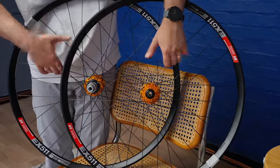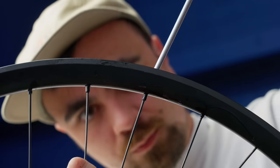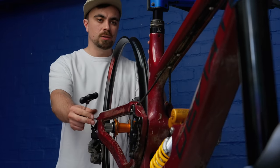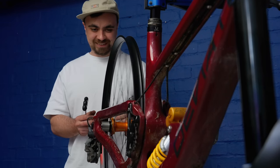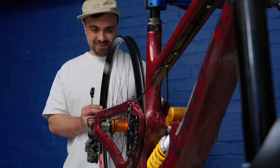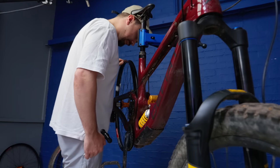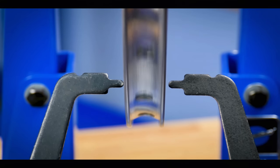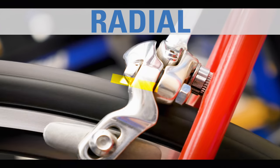These two fully-built, fully-trued, tried and tested wheels — I tightened the spokes on both wheels to what felt like half tension, then stuck them on the bike and hoped that they were round. It's not looking good. Oh dear. Jesus Christ — it's like an inch of wobble. It's at this point you'd want a truing stand. You'd put the wheel in and it would accurately tell you where it's off from the hub, both laterally — that's side-to-side wobble — and radially, that's where it's not round. I didn't have that.